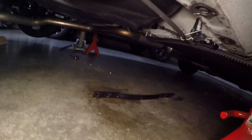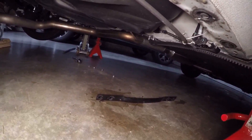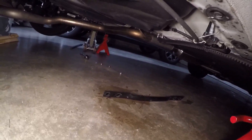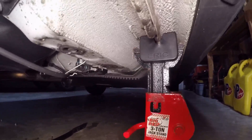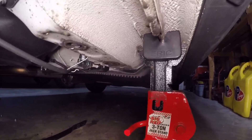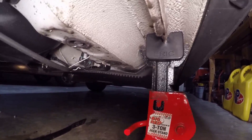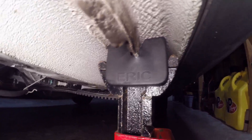To do the exhaust work I do have to remove that rear brace so it can drop down another six inches. Just make sure you get the hanger that's close to it or you'll stretch or break that rubber — there's a hanger almost right across where the camera's pointing that I had to release. If you want to look at the jack stand adapter deeper, go to a video two or three previous and there's a link if you want to get those. So far I'm really happy — crouched under here I don't see any cracks at all.